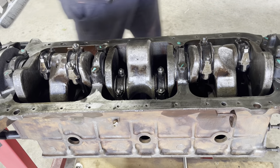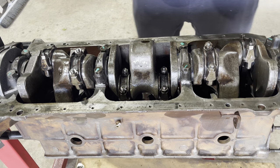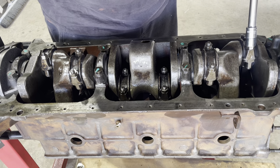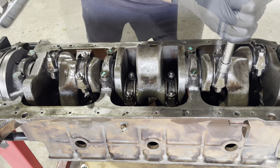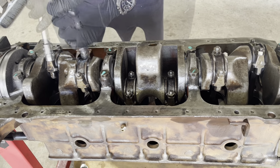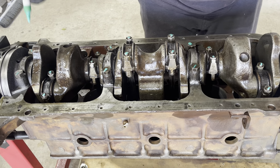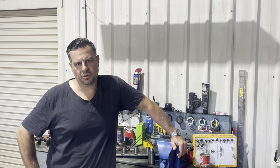All the pistons are in - didn't want to bore you with too much repetition. Now what we're going to do is torque down the con rod bolts. Specs say 35 foot pounds which I'm set and ready to go. Let's put the locking bolts on - they've been torqued down. I'm going to end the episode there. Hope you enjoyed it just as much as I did - don't forget to like, subscribe and I'll see you on the next one.